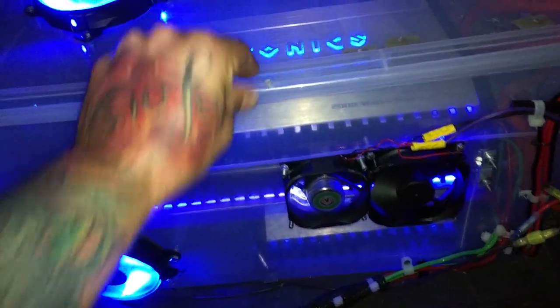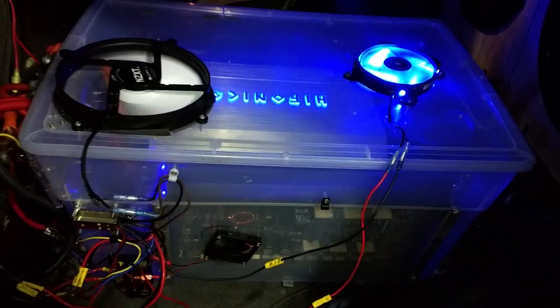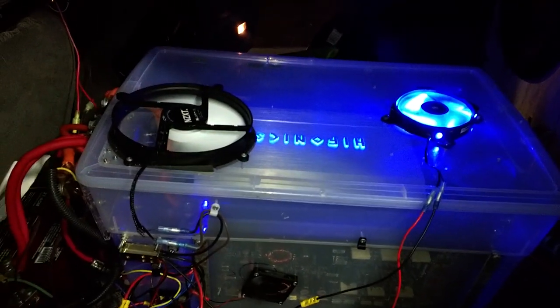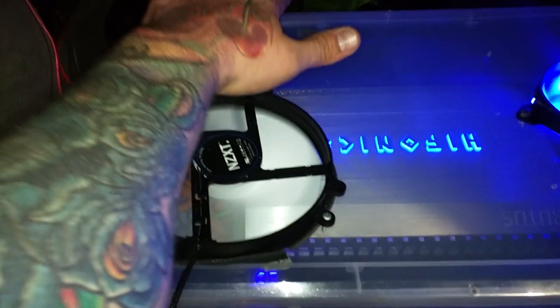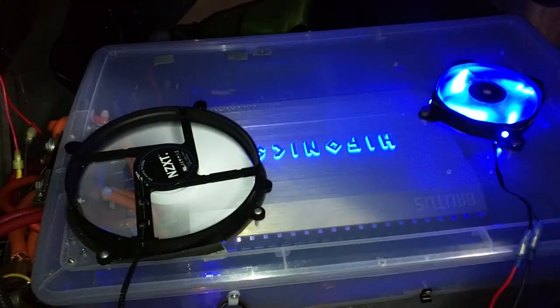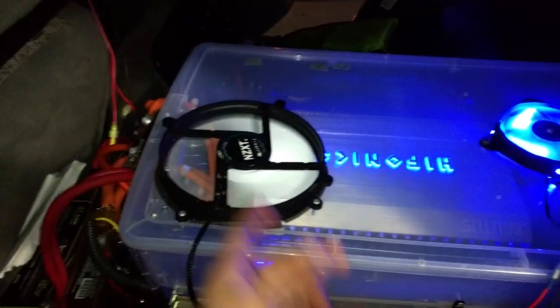This top does come off like this — I usually have screws in right here. As far as an enclosed space, if you're pushing a lot of watts or you've got big boy amps, a lot of the super class D's nowadays don't have built-in fans. Georgia gets hot in the summer and amps are prone to overheating. So nothing better than sucking air in from multiple sides. When I first did it I had the big fan mounted on top thinking the CFMs would add together — it doesn't, it actually disrupts the airflow.